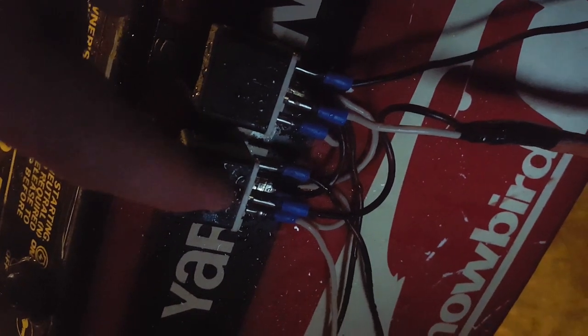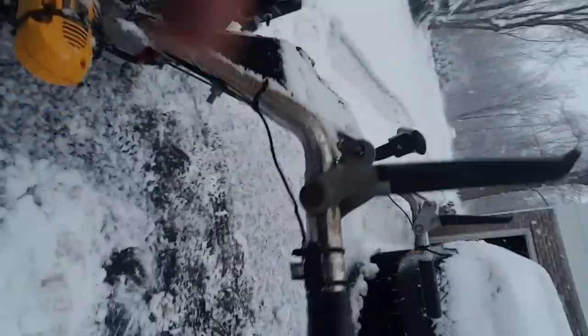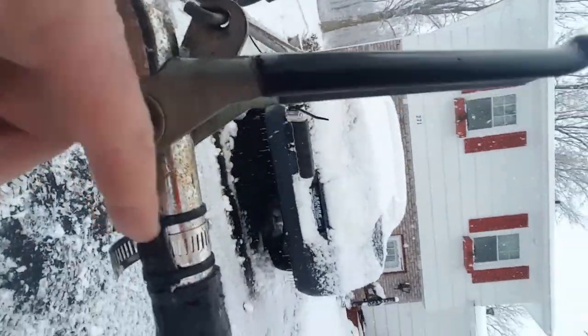Both sides of the drill are seeing ground the way I have this wired. You can't get a motor to run on two grounds. What makes this thing run one way or the other is when I cycle this relay — it will jump from supplying a ground to here, to supplying a hot to here. This side is still grounded, so it'll turn one way. When I actuate this one, it supplies hot to this side and this side is normally grounded, so it'll run the opposite way. What isolates the ground from the rest of the handlebar is just a tab I cut up.